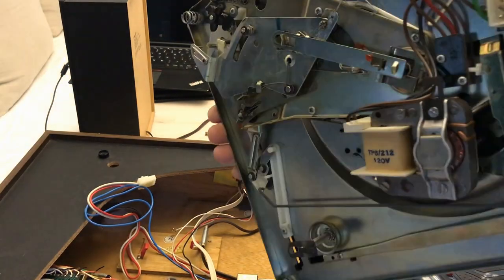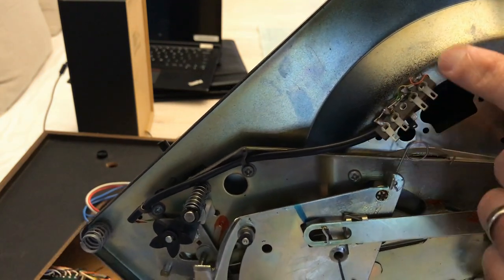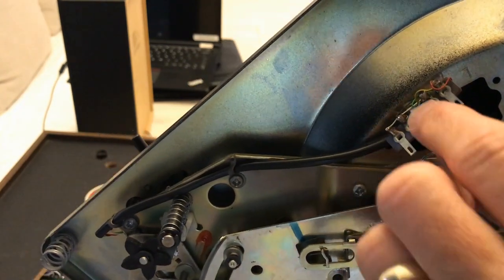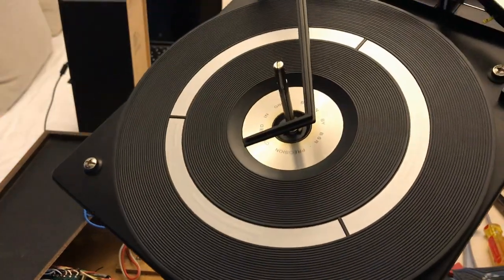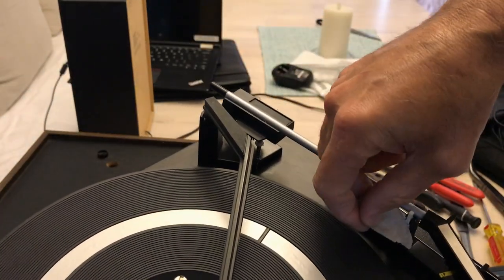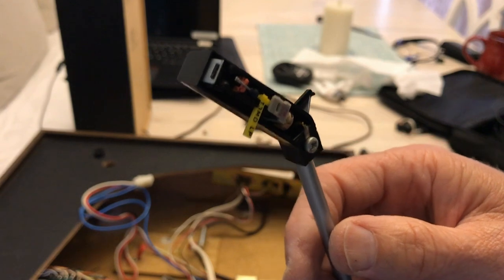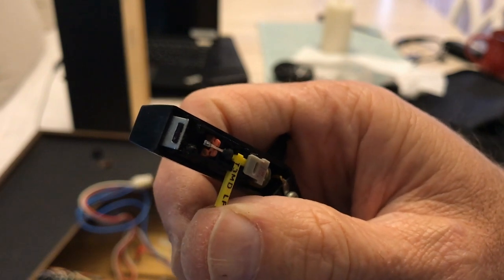I got all lost and I didn't know what I'd done - I put it back together two times and it sounded horrible. The two arms go here either side on the outside, and there's another thing that connects right there in the middle. It's sort of like a grounding thing evidently, because it will not work unless it's grounded there. After some trial and error I figured that out. When I took it apart I wasn't very careful - I just kind of pulled that off. I've just taped that down so it wouldn't fly all over the place. The other thing I had to do was replace the needle - when I was a kid my brother always did that, so I had no idea what I was doing, but I could find them online.